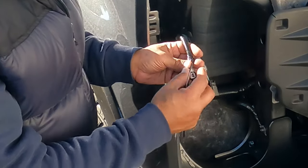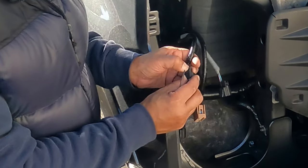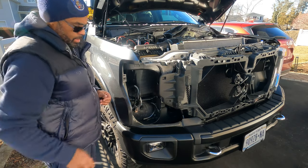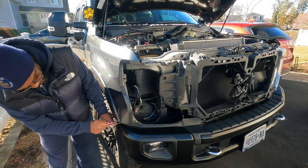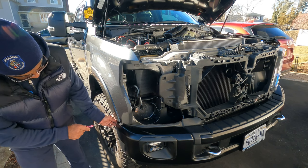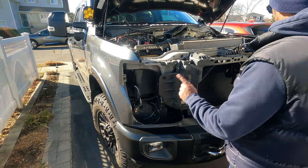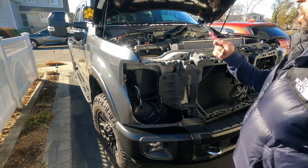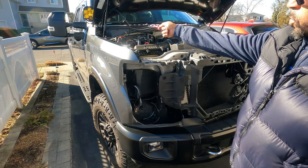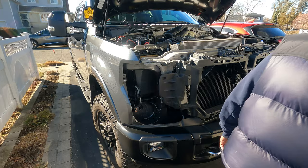This is the side marker lights. Again, same thing. Over here, you see a little push lever, push down, pull out. Okay? So that's done. This is removed, and again, there's another screw between the bumper that you have to remove. I ended up removing it without dropping my bumper. That's the first thing I did. So now, this is off. So let's take off the right one, and then we're going to hook up the wiring from here and fish it from the fuse box to over here before I put anything on. So let me get that set up and going.